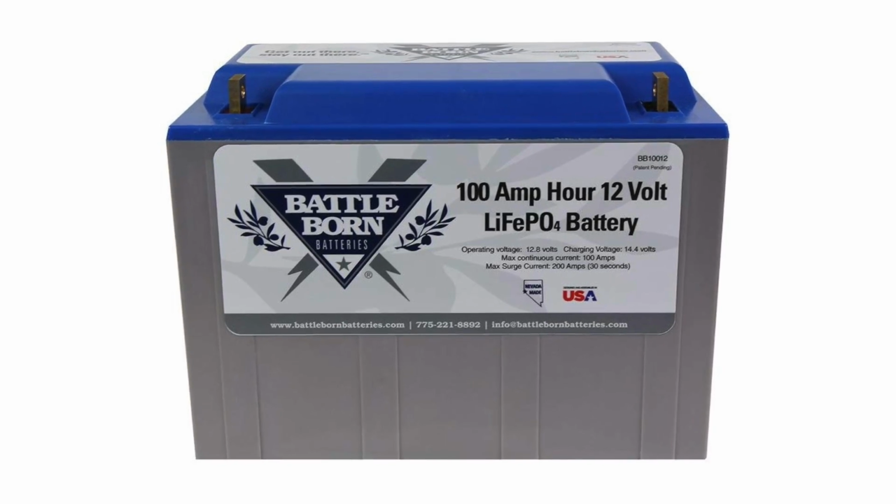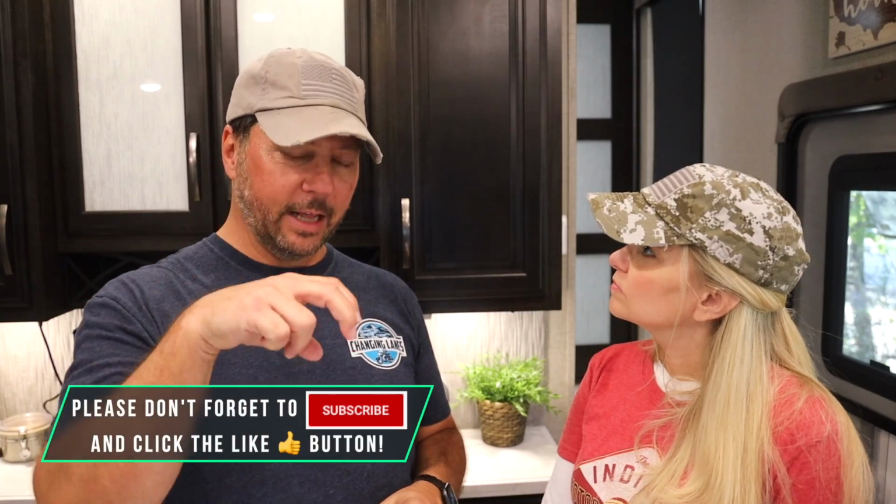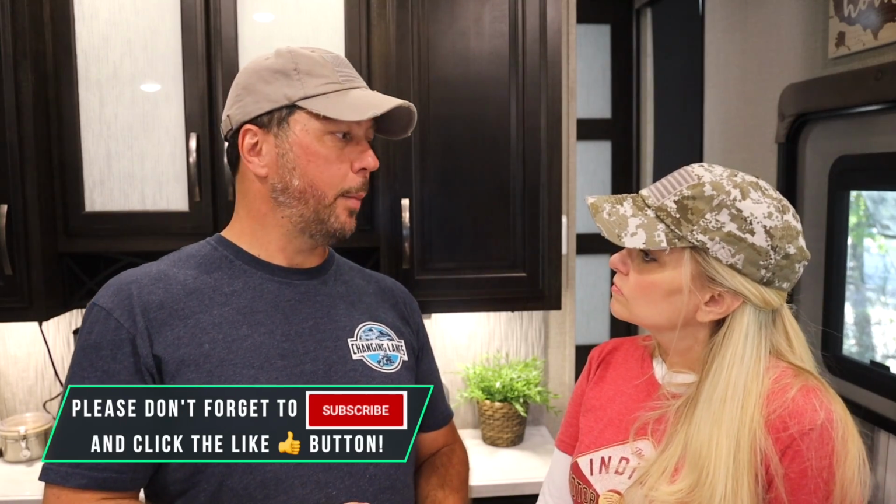Battleborns are rock solid. Another thing about most lithium ion batteries is they're going to have a battery management system, or a BMS, built into each battery. And that is like a little brain inside there that shuts off your battery if it's too cold, shuts off your battery if it's too hot, stops the outflow of current before it gets too high. It protects that battery and also balances the cells. They're really, really good, but they are really expensive. Yeah. If you want to do what we did, we bought some flooded cells for our first year, and then we upgraded to Battleborn.